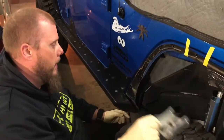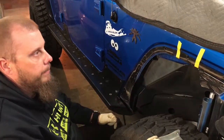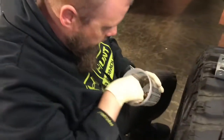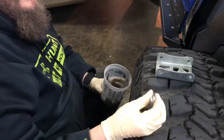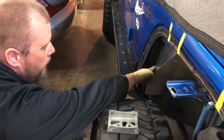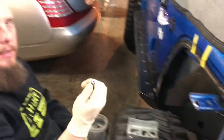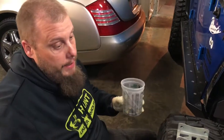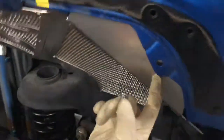I'm going to drill these holes so the fender liner lays on top of the bracket. They give you these nice Allen head stainless bolts. They originally have you put these somewhere else, but I use them right here and it finishes off really nicely. When you look up under the fender well you see these nice stainless button heads. That's how I'm doing it - you don't have to do it my way, but at least this gives you an idea.